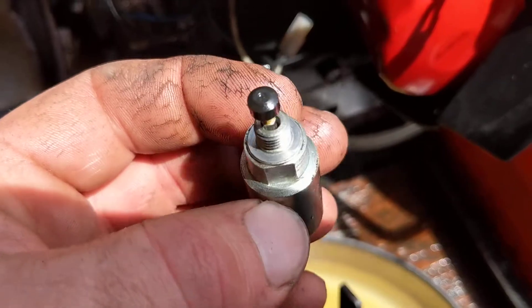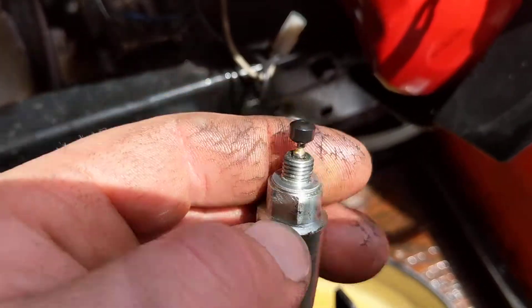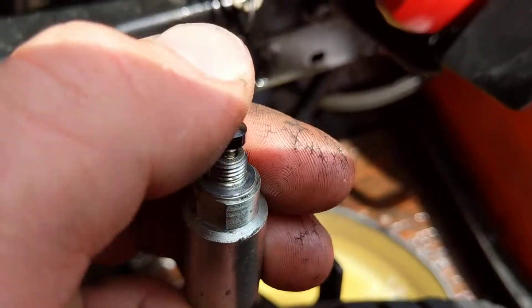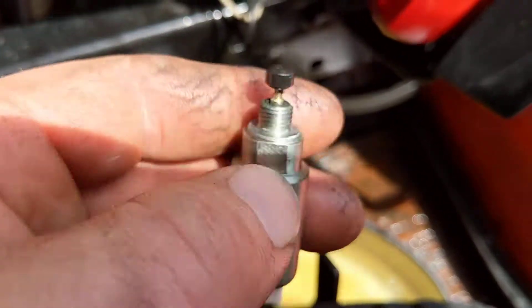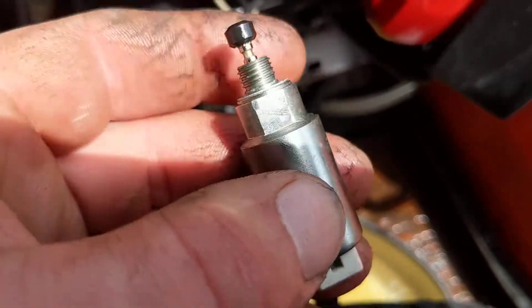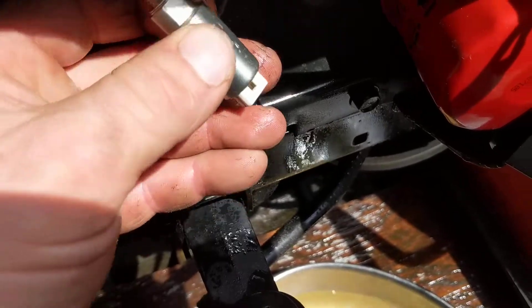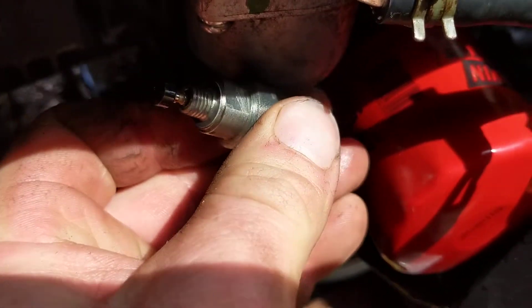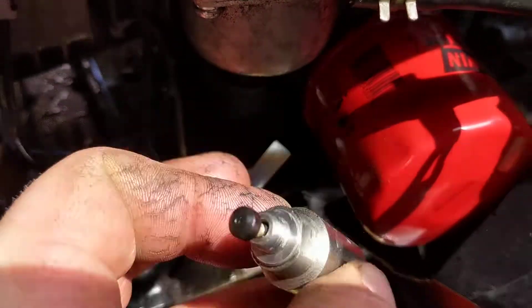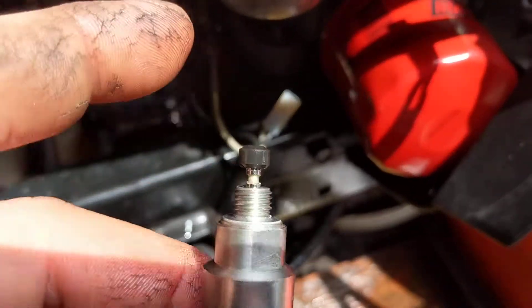They're expensive, so don't buy one if you don't have to. A really light penetrating oil down inside there — bounce this up and down a whole bunch — and you'll probably find that it loosens right up. Blow it out with some compressed air and you'll be good to go. If you connect this and lean it against the side of the engine and have your friend turn the key on and off, you'll hear it and feel it, and you'll see this plunger move up and down.